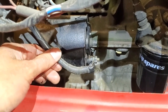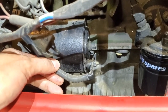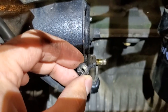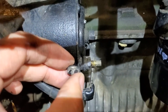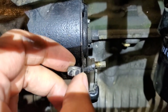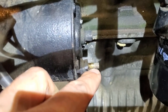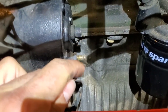While I pulled the distributor, I also noticed that the starter wire isn't well secured, so I'm going to clean this up and re-secure it properly. No wonder this car is having starting issues. The nut that whoever previously assembled this used is the incorrect style — this is a British thread and this is just a standard, probably metric-sized nut. More issues caused by someone assembling this indifferently. I'm going to run a tap across here, clean up the cable end, and find the appropriate nut for this.